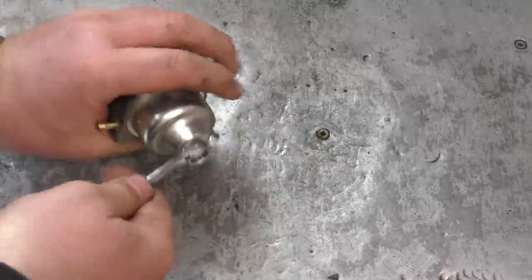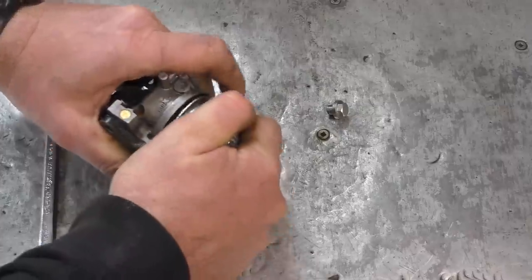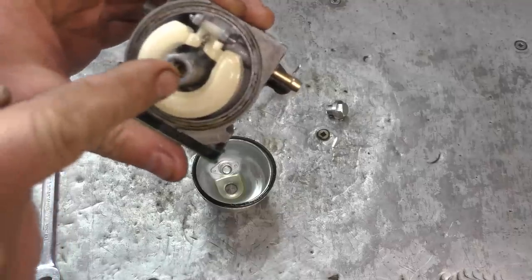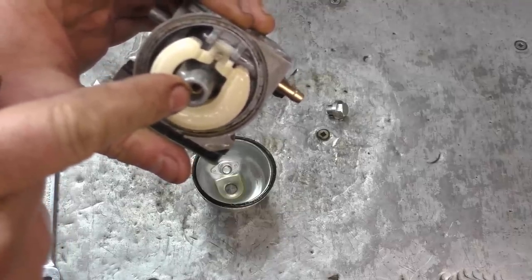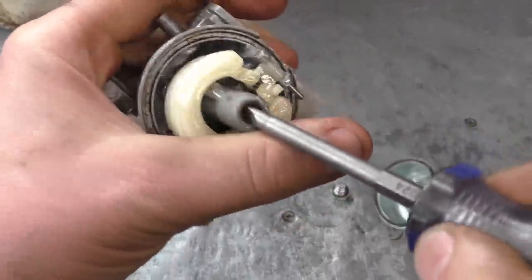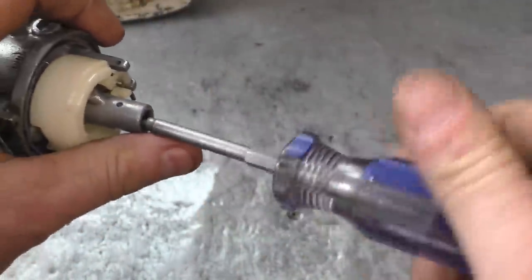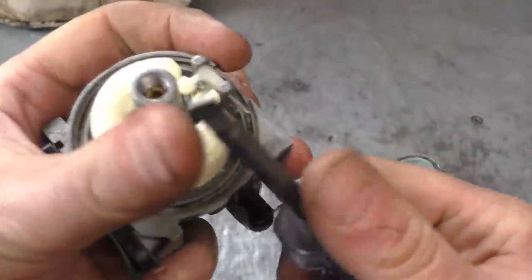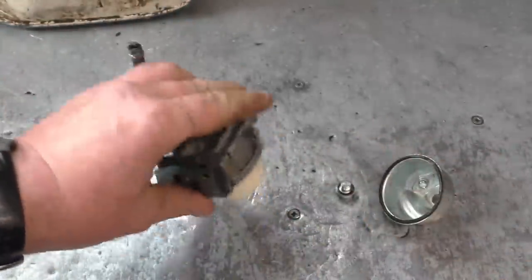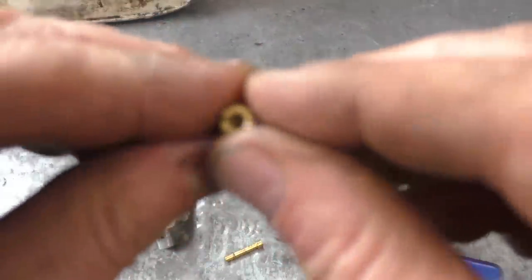Okay, let's crack this carb open - this will tell us the whole story here. This carb is not too bad, guys, but usually what happens is the small jet inside here and the emulsion tube get dirty. It doesn't take much to clog it up either. I'll remove the small jet - by the way, these are gunsmithing screwdrivers. I've got the whole set; they're great screwdrivers if you work on small engines. If you look in this little jet here...